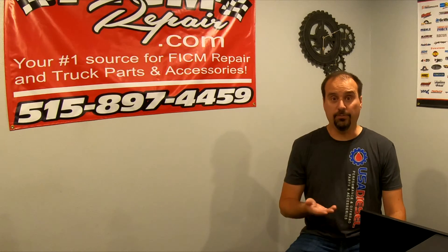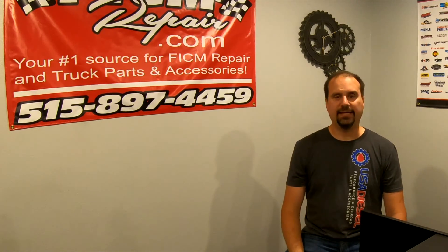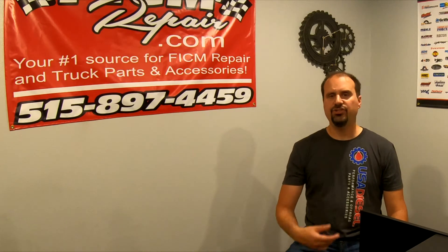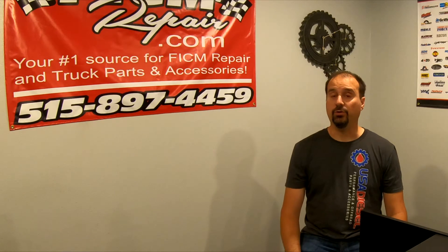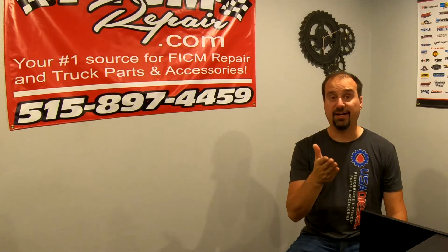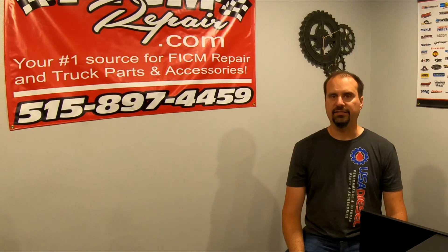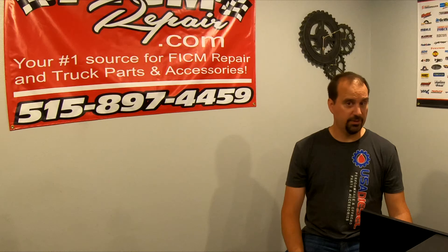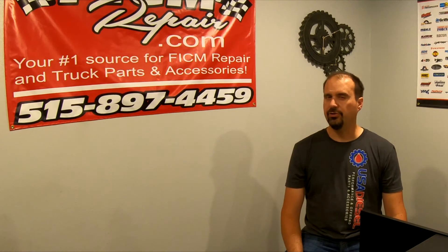Which one to pick? Consider your battery type. Most of us are running lead-acid batteries. The issue with lead-acid batteries is they can be charged up to a 15.7 volt rate and they'll be okay — you won't overcharge or out-gas them. AGM batteries, however, really shouldn't be charged at that rate. Most AGM batteries don't like to be charged anything over 14.7 volts, and outside of Odyssey, no battery manufacturer I'm aware of suggests they can handle anything over 14.5 volts. So if you're running lead-acid today and have no plans to switch to AGM, maybe the 190 amp alternator is good enough. But if you want to reserve the right to run AGM batteries in the future, you should probably be looking at the 230 or the 270.